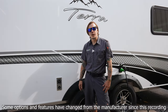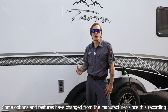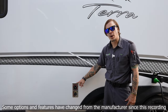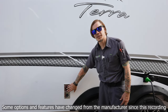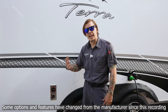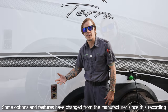Next up is our furnace exhaust vent. This is not a customer-serviceable piece of equipment. The most important thing you can do is protect it from mud daubers and flying insects using an aftermarket screen kit that clamps over the exhaust vent. Also keep in mind not to set anything in front of it — the furnace needs to free breathe, and this blows very hot air that may melt anything placed in front of it.